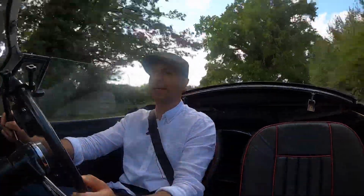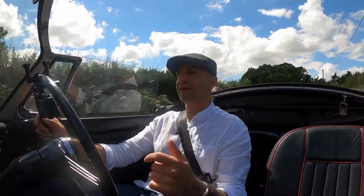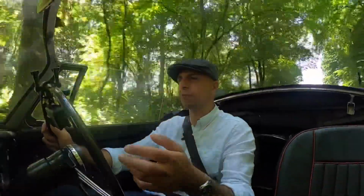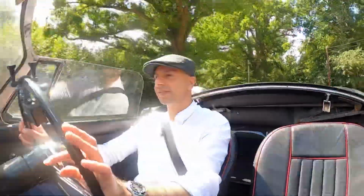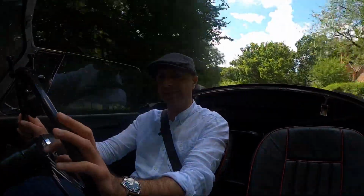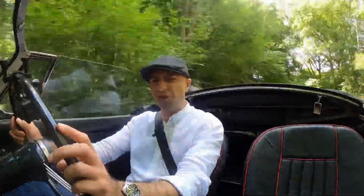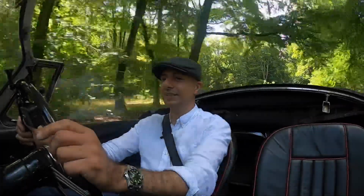It's a bog standard engine, electronic ignition, and it has a new battery and a new coil that gives it a bit of zip. It hasn't been modified with a hardened seat, so it can't take unleaded petrol, so I have to put an additive in. But that's not bad, is it? That went alright, and it's great fun. And originally it was supposed to do 0 to 60 in 11 seconds. I don't know if it's going to do that now, and I'm too scared to even try it. If I find a clear road with a 60 mile per hour speed limit, I'll give it a go.